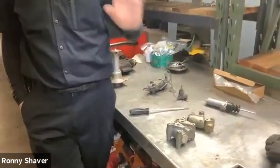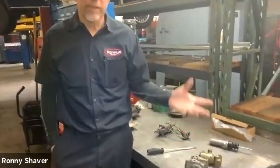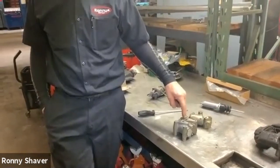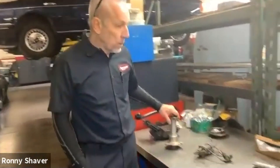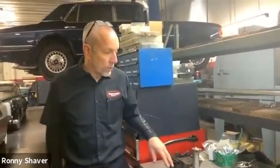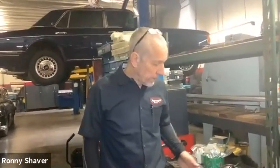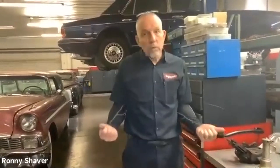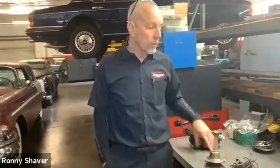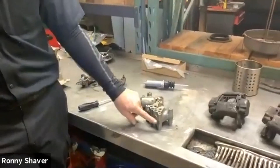I ran into one case where you'd run the car, the accumulator was great, had great gas pressure, the system would build pressure great — but then you'd turn the car off and 15 minutes later the warning light was on. There was a pretty worn distributor valve that allowed high pressure to bleed back into the reservoir. Another source for the number two light coming on too quickly is the height control system: if you've got valves that aren't adjusted properly, when you park the car that accumulator is still trying to hold it up. It gradually bleeds off pressure — it's not static — and it bleeds by in the system. All the connections at the tubing are not where it leaks; typically the leak is only from these distribution blocks right here, where they seep.